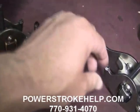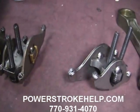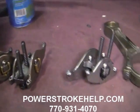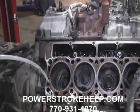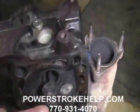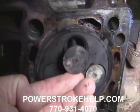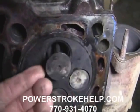At that point the motor started to skip very shortly after and we couldn't figure out what it was, so we unfortunately had to remove the cylinder heads from the truck. The worst cylinder for compression was number seven, the rearmost cylinder on the passenger side. When we took it apart, we had one of the intake valves where the guides are so blown that it's just not going to seal correctly.